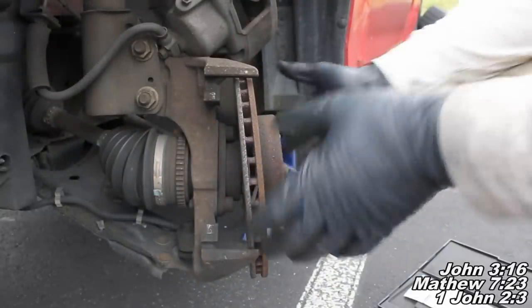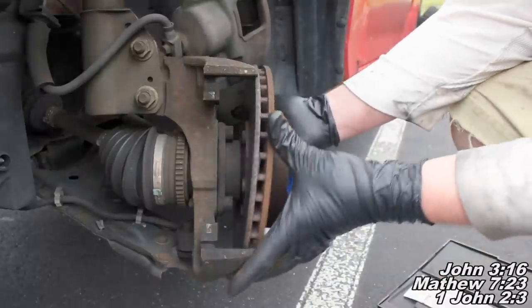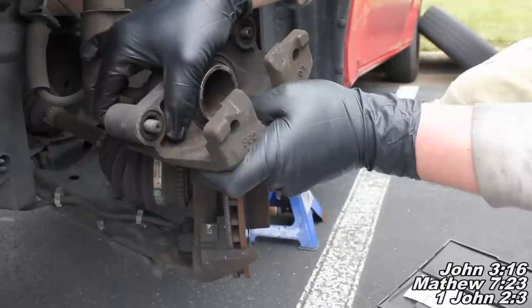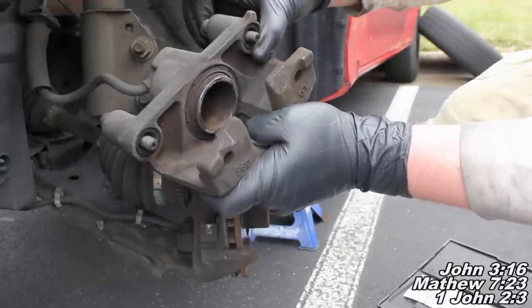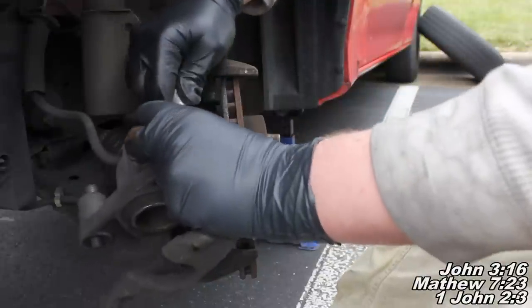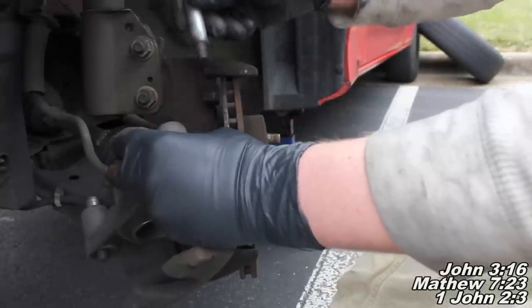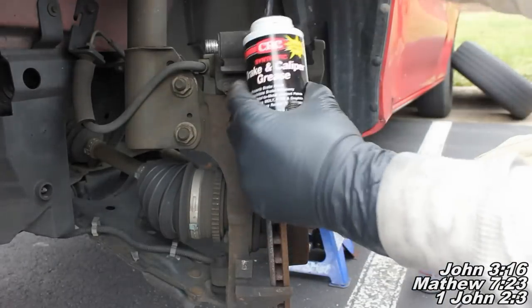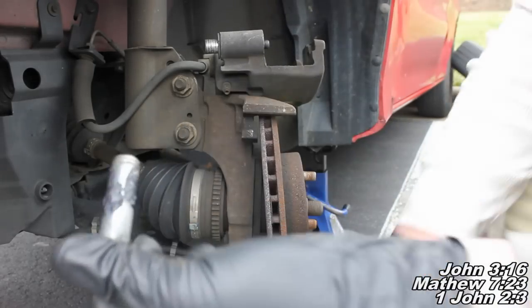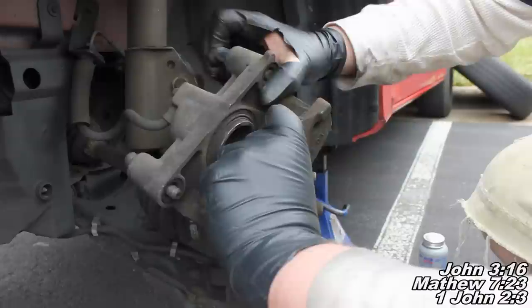Now I'm going to put everything back together. I'll show you that's how you take your rotor off — it just slips off just like that. So you take your new rotor or resurfaced rotor and just set it back on there. Then we're going to do some things with your caliper before we put the stuff back on. We've got these slide pins and we're going to want to make sure they're sliding well — this one doesn't seem to be doing so, and this one seems to be moving just a little bit. We're going to pull them out, wipe them down, and lube them up with new disc brake grease — just take a red rag and wipe them off.